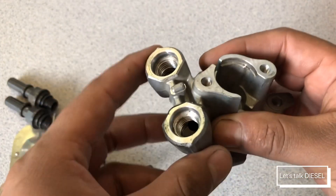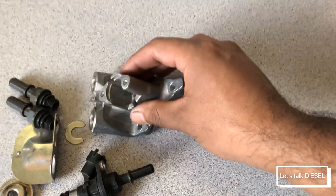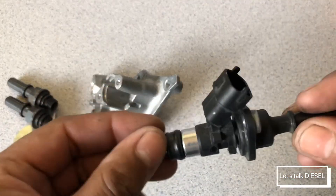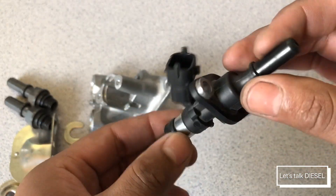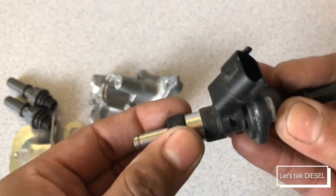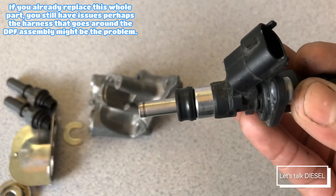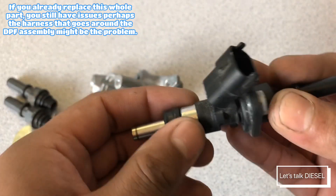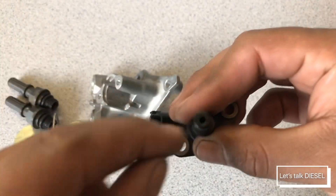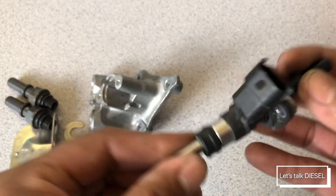For sure I know Volvo uses them. The main part of interest is this nozzle — this is the electrical part that makes the mix and sprays the DEF when regen is taking place. So just put some hot water in here and try to clean it up nicely.